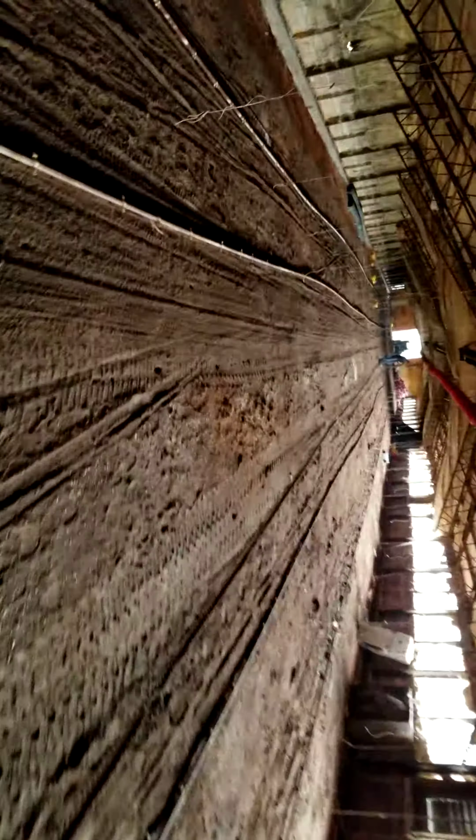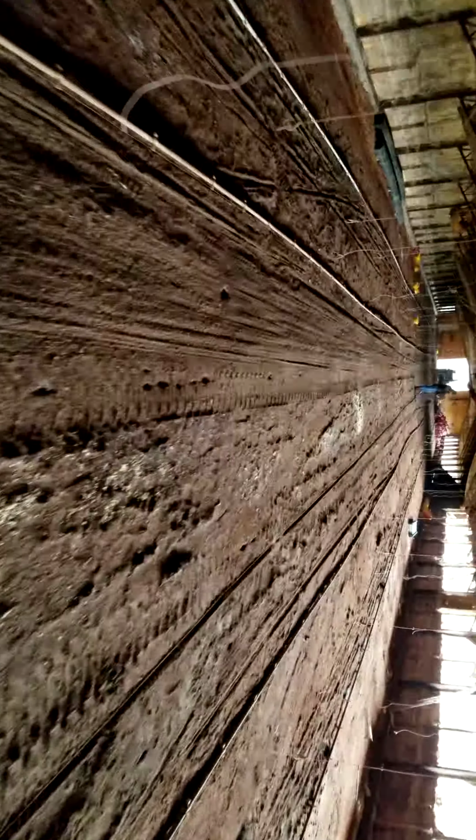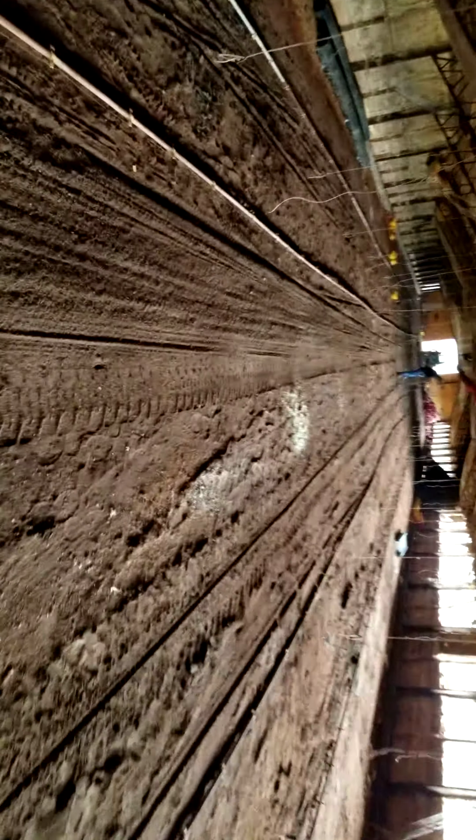And then what I did for the ease of the process was, if they're in a good straight line, then you just start a roll, tie two little wires for the very first roll to keep the end tucked in well, and then you can just walk down, and that's what Austin is here doing. You can just follow that line down the whole way, just making a big roll of it. Now it'd be good to have a couple extra wires to hold this together. That would help this process. But anyways, I'll get you wire here in a second. So that's basically just roll it up like that, and that gets your auger out.